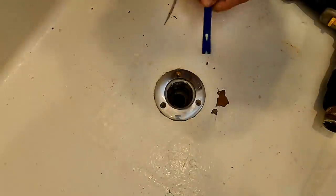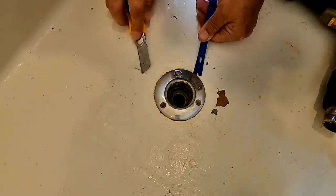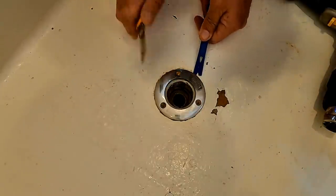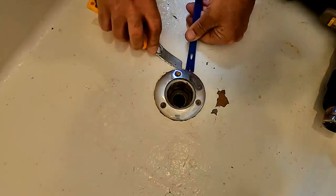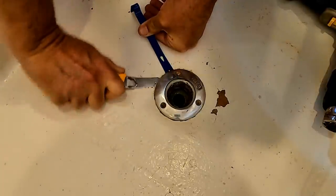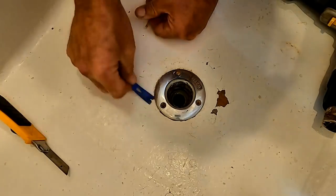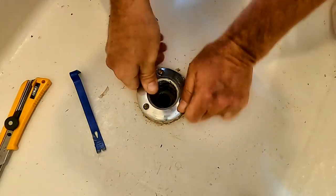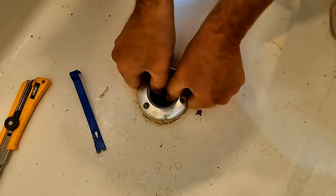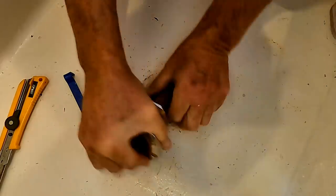Let's see what that's achieved. If I can pry up a little bit and get the knife under — oh, that's a lot better than it was before. It softened some of the paint here as well, but that's a small price to pay. Heat really is the only solution for horrible 5200. There we go — we're getting some real mileage here. I'm not sure I'm going to be able to fish this out, but — oh, that's hot. There we go. Now, can we fish it? Yes, we can.